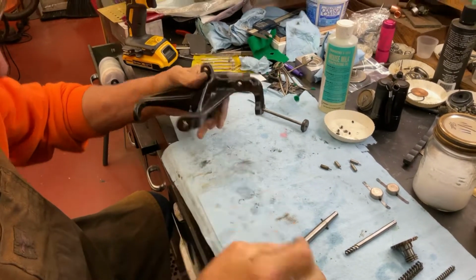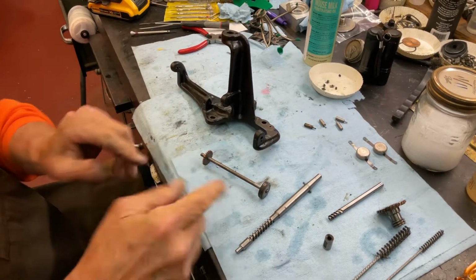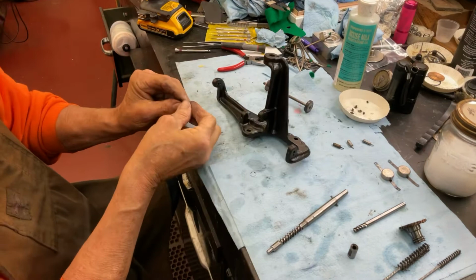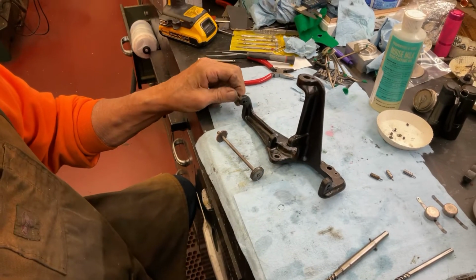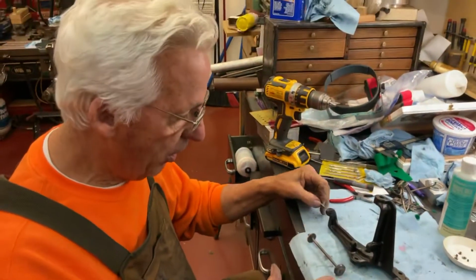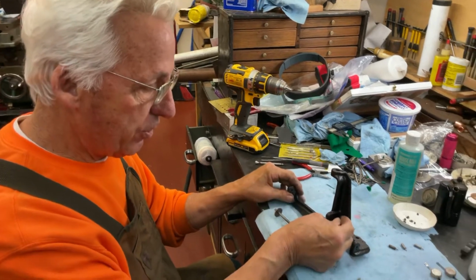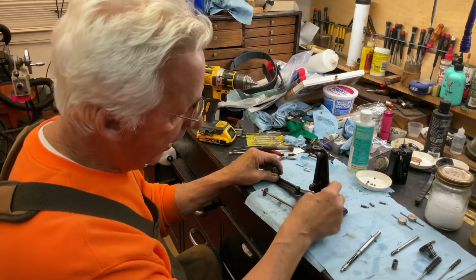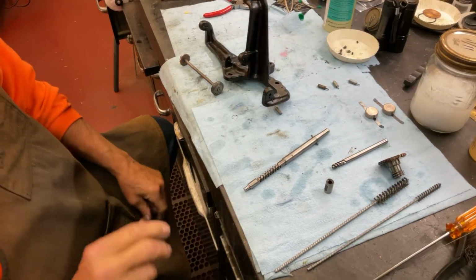Next, on pre-assembly, the governor bearing and the record tracking gear here use the same bearing. So you want to take your bearing, and this is where this gear train fits here. You want to push it in and make sure that it moves in smoothly, because you're going to have to adjust these. So I go by and check all these, and I'm going, this one works here, good for the governor. The other side over here works good for the governor. It pops back and forth. And I know that I go over here and that one doesn't want to fit. So that means it's supposed to fit there? It's supposed to fit there.